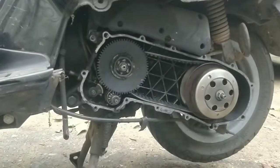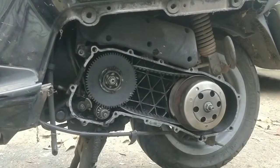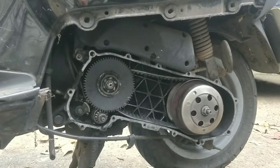Lovely. Obviously, there is a specific torque setting for that. I've been doing this for enough years to know that that will be okay. And I used enough thread lock on that. I probably will get my torque wrench out and just double check it anyway. My torque wrench is a bit old, so I don't know how reliable it is anymore.